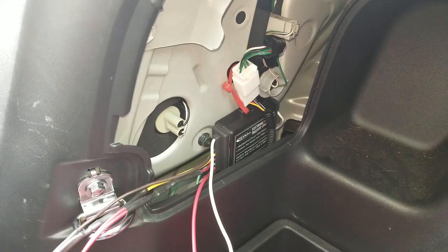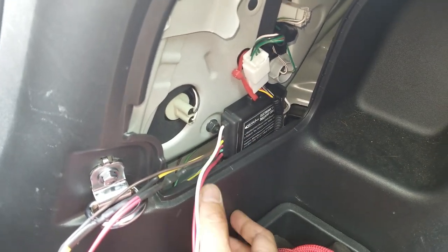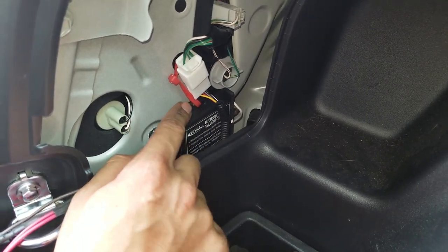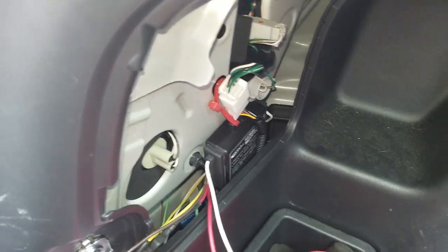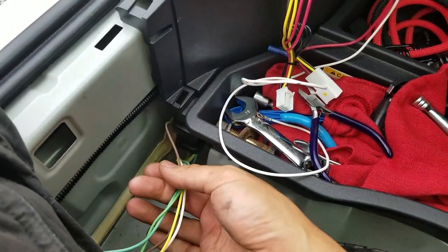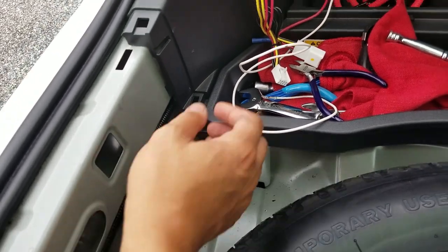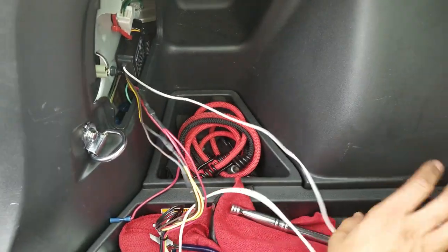I fussed around a bit to figure out the best place to mount this. Mounting it down under might be better, but getting the paneling off is a huge pain, especially if you need to get to it again. So what I've done is tucked it behind the harness up against the car, then wrapped a longer zip tie through the back and around to keep it in place. I've taken the green wire as well as the flat 4 wire and dropped it down through here, grabbed it from underneath, and pulled it through. I'm going to secure it to the existing wire loom harness with zip ties, leaving a bit of slack. The ground wire is left out for now and the power wire is here.